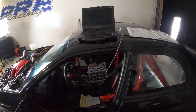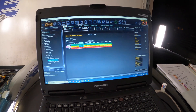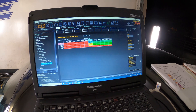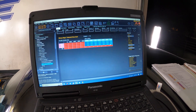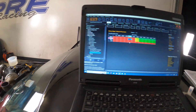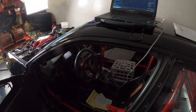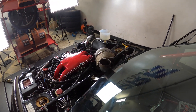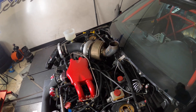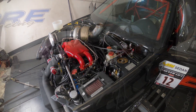So just getting the mapping dialed in for some fun nitrous control stuff — just a generic dry strategy. It's going to add some fuel as our duty cycle comes up and it's progressively controlled. Right now I have the window set so it'll progressive in and then send it out the top. Or we can progressive the other way if we just want to use it for launch. Nobody ever complained about partying with nitrous. We don't really want to get into the wiring inside the car — it's pretty haggard at the moment just because we're thrashing. Steve says keep the wiring off the camera. It's not pretty, but it's going to work, and that's what matters.